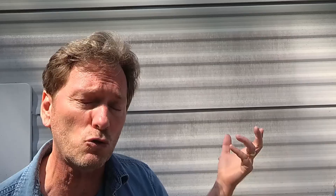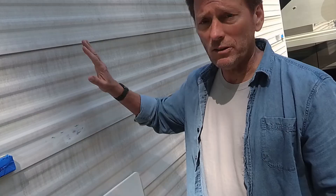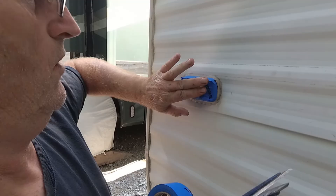If you've really got some caked-on or rough stuff, I'd recommend going over it with a Scotch-Brite pad to remove any of that, or if it's overly glossy you really want to kill as much of the shine as possible. As you can see the sides of this are really oxidized out. It had some stripes that they had to remove, and we're going to mask out all the lights and anything that doesn't want to be painted. We're going to try to paint it in two-tone colors.